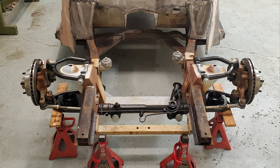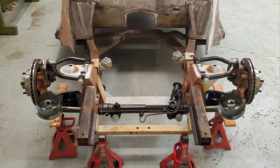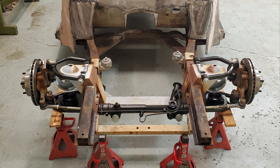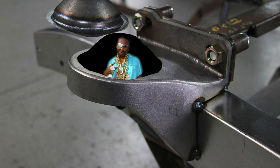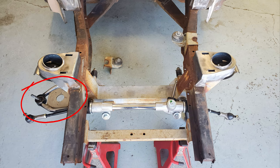I had ordered a whole bunch of suspension components after I got the car up on jack stands and assembled the front suspension. I purchased a bolt-on bracket to convert a standard Mustang II shock tower to airbags. I didn't like the way it fit and it seemed sketchy how it bolted to the tower, so I ended up cutting the spring cup and shock mount off the top of the tower to section in the bracket and weld it in place. I also raised the top of the shock tower an inch. Next, I cut the spring cup off the lower control arm so I had a clean surface to bolt the airbag to. I also switched over to a manual steering rack, as the setup came with a power rack and I did not want power steering.